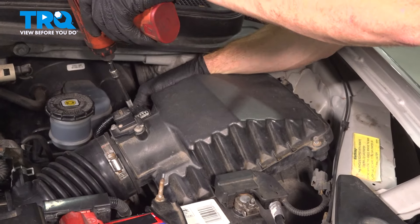These bolts will stay in place on the air filter housing. Let's take hold of that air filter housing now — we're going to lift this up and out of position and slide it off of the inlet tube. We'll give that a quick inspection and set it aside. With that out of the way, we'll dislodge our wiring harness from the side of that inlet tube.